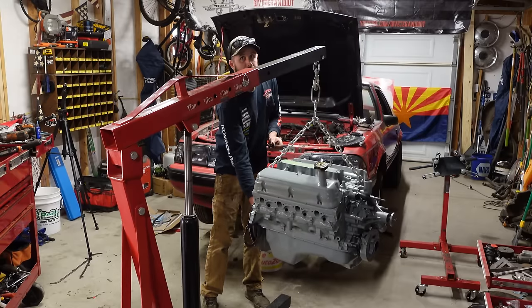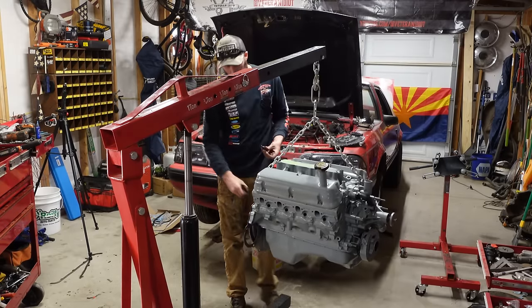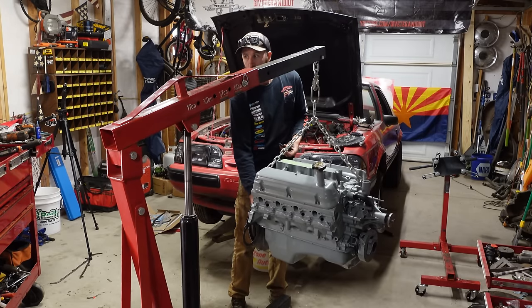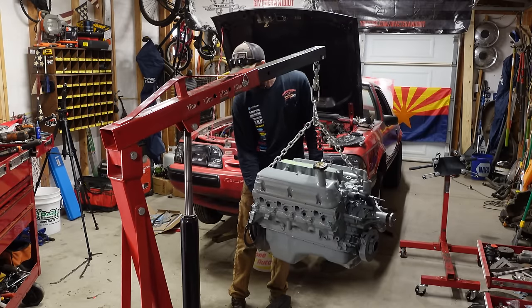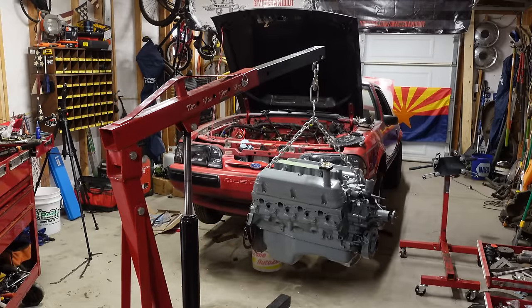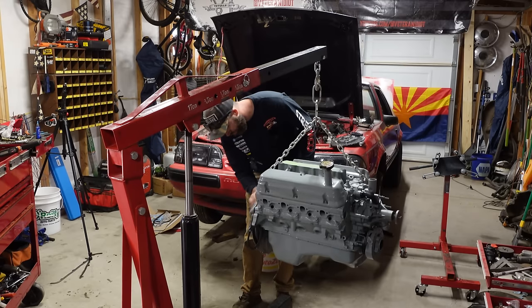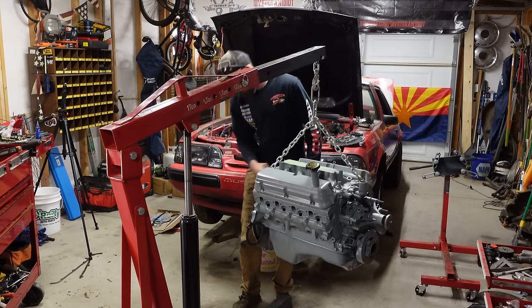This Mustang is a 50 ounce imbalance, in case you were wondering. 351 can either be 50 or 28. This particular one I got behind me over here is a 28. So when we ordered all that stuff to swap it out, I had a 28 ounce flywheel. Had to exchange that one back for a new 50. Now we're back, ground zero, 50 ounce imbalance. Sweet, clean it up with a little brake cleaner, a little wipey wipey, so we don't get any hot spots and all that other business everybody hates. Chattering clutches.